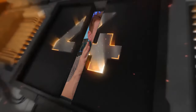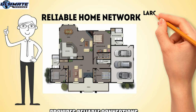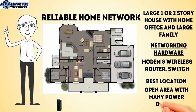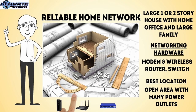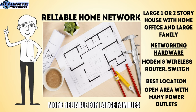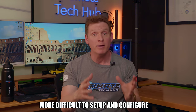The fourth home networking diagram is the reliable home network setup. This is a great setup for those who work from home and have a large family, providing a reliable connection to work-related devices like laptops and computers, while also providing enough wired ports and wireless connections for the entire family. The hardware components are the same as the basic home network setup — the only difference is the configurations. Work-related devices like computers, printers, and laptops connect to the router directly, avoiding a single point of failure in case something happens to the network switch. You may also want to get a UPS — a backup power supply — for all your networking equipment and work computer, so if the power goes out, you'll still be up and running. The upside is more reliability and avoidance of a single point of failure, but the downside is that it's more difficult to set up and your work-from-home devices need to be close to the router.